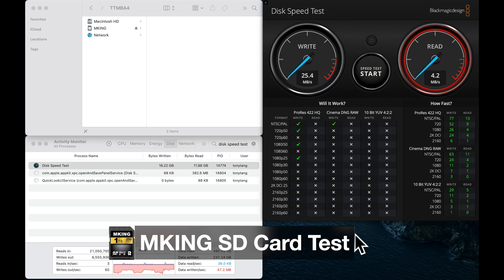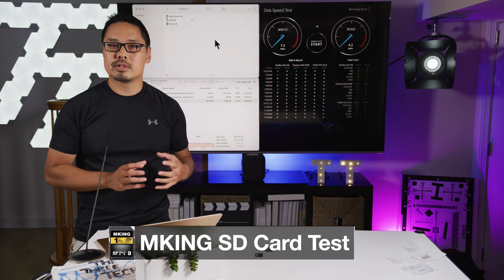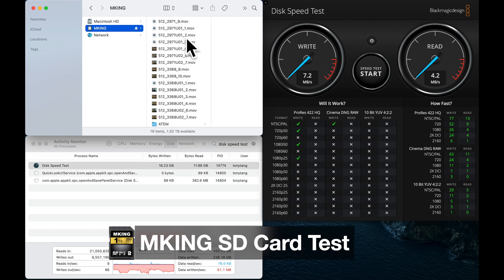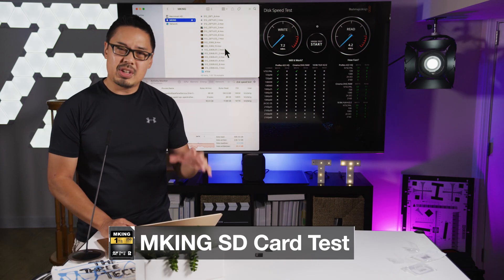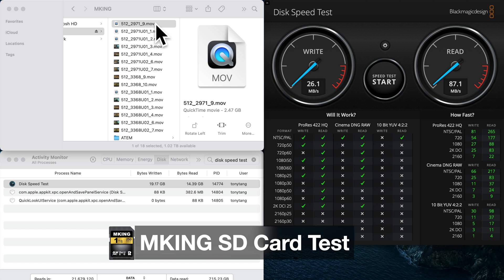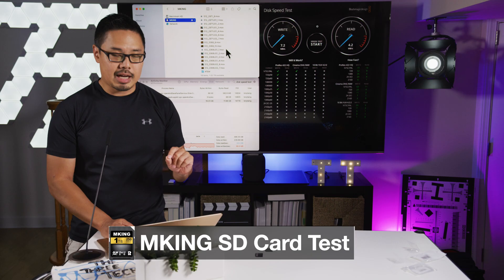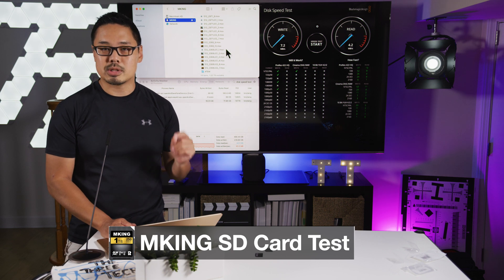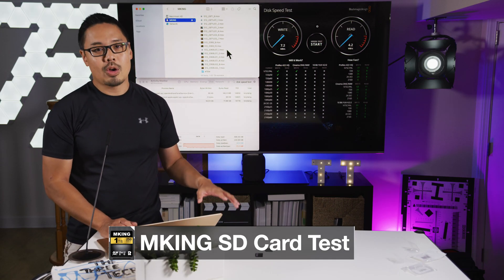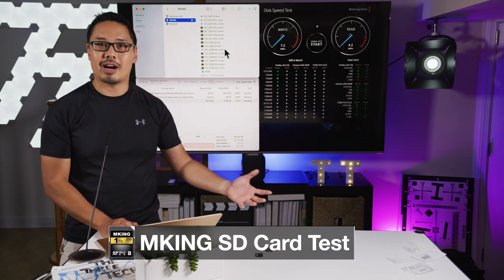The other thing you want to test is whether the card is reliable and stores the true advertised capacity. I copied several video files — close to 60 gigabytes — over to it. The first few played back fine, but as I copied more I started seeing errors and glitches during playback, meaning the data became corrupted or may not even be there. I would conclude that this card is either defective, poorly designed, or doesn't actually store one terabyte of data reliably.